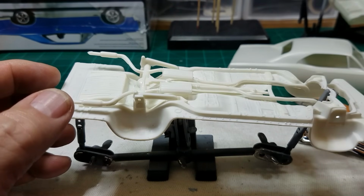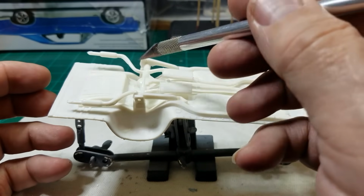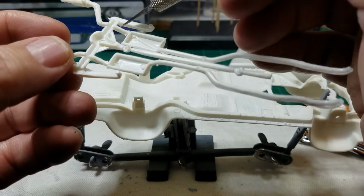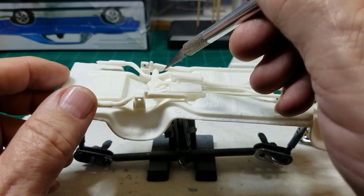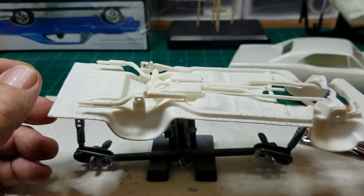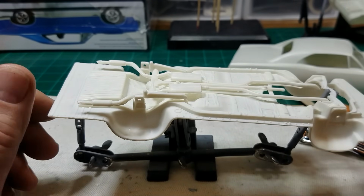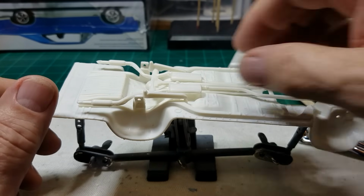The only other thing I could do to adjust this would be maybe to cut off these tailpipes, cut the exhaust pipes at the axle or just before the axle. Yeah, that would be solid, so you could sand that smooth and you wouldn't see those. And then dump the mufflers like right in this area, put down turns or something, or just leave them open from that point. Or I could just delete the exhaust pipes, go with the headers, and just have the headers dumping back here. I could do that. I haven't made up my mind yet, but that's a little update.